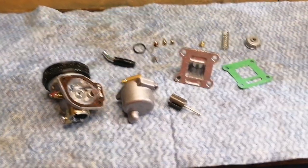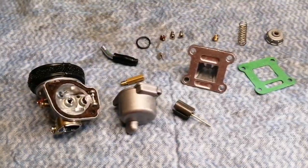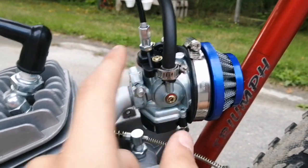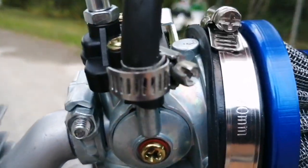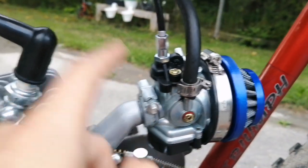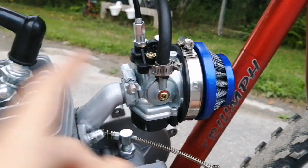With that carburetor, it's going to allow the engine to get into the higher RPM range. And once I go ahead and throw an MZ clone on there or some other various upgrades, it's only going to help the performance. Also, the fuel inlet on this carburetor is slightly smaller than your standard one. So even on the stock fuel line, you'll probably have to install a hose clamp like I've done here and you'll get no fuel leaks. And this bolt with the nut — the 10mm hex — works a lot better than the standard M4 hardware with a brass Phillips. Instead of that, we have a stainless steel bolt here.